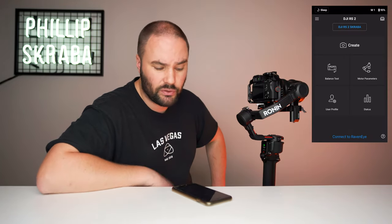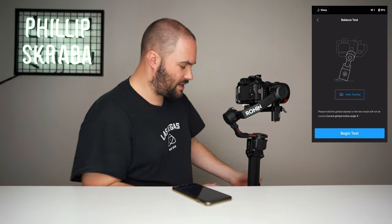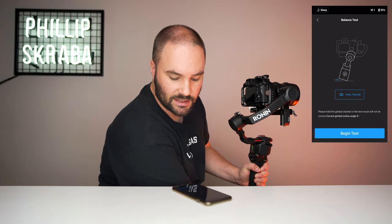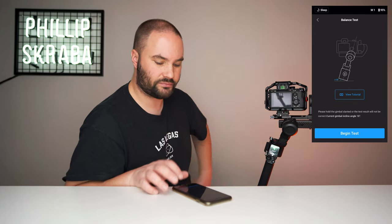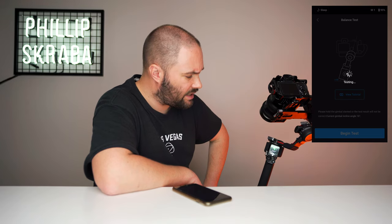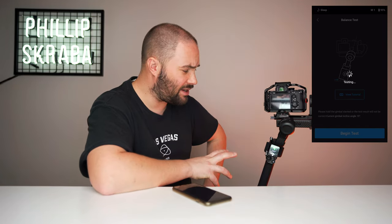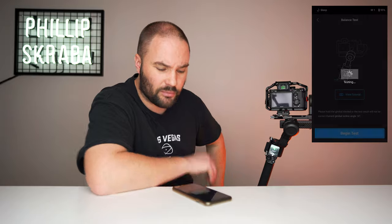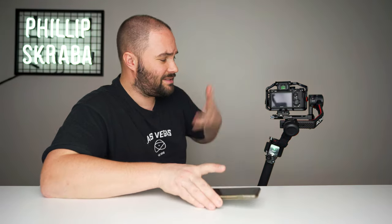You can also adjust them yourself if you want to. The next thing to do is a balance test. I do have this on a tripod by the way, so it's easy for me to get down to 15 degrees, which is where the balance test should be. 12, 13, 15 — there we go. Now that we have this at 15 degrees, it's going to do the test. The test should come out on your tilt, pan and roll: Excellent, Excellent, Excellent. If you've done it right, that will mean that your motors are completely set up for your camera and they're not going to get tired or go to sleep when you need your gimbal the most. That is the balance test result — you guys should be seeing Excellent, Excellent, Excellent if you've done it correctly. And that is basically it.